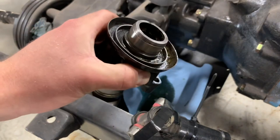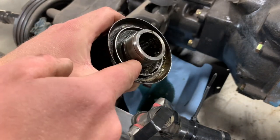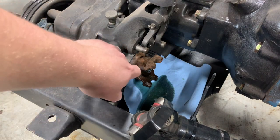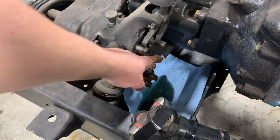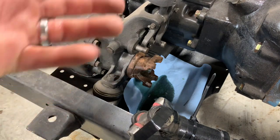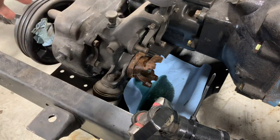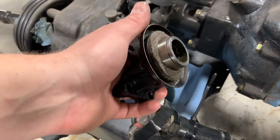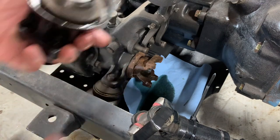Now that we've got this thing sleeved, it's ready to go back on. I'm going to grab that new felt washer to put in there. I'll be honest - my trick of putting a spare yoke in didn't work very well; oil is still coming out, not as bad as if there was nothing there, but I'm going to suggest if you do this job you just go ahead and drain the oil out first so you're not wasting oil or making a mess. Got that new piece of felt on, so we're going to pull this temporary yoke out and put this new sleeved one on.